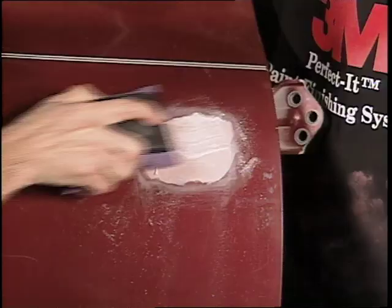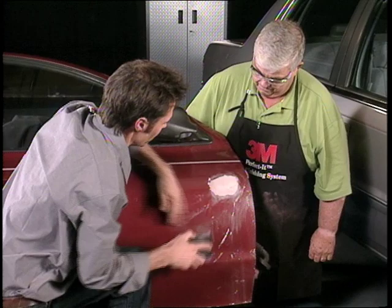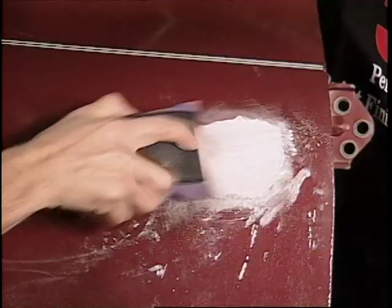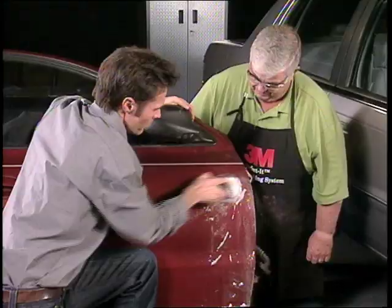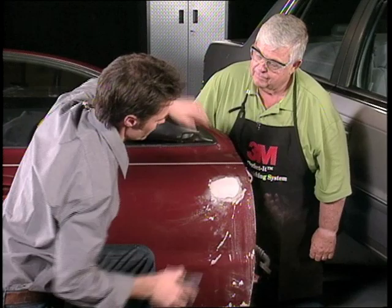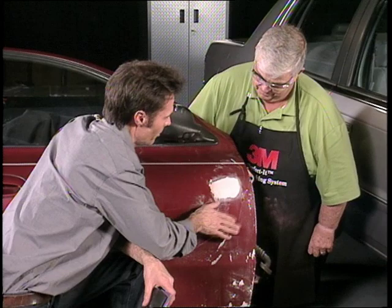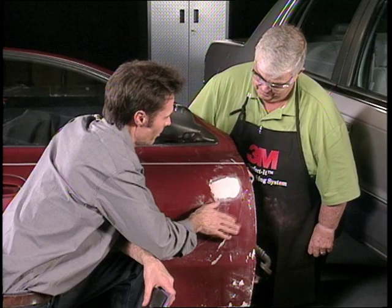Well, let me get sanding. And as you pointed out beforehand, you don't want to sand too much of the body itself — you're going to be contained in that area. Oh mate, it's bringing back the memories — the smell of Bondo. Smell of dollars! You know, one of my first projects was 177 door frames — I must have used 20 gallons of Bondo. That's feeling good. So it's 80 to the 180, and then it's prime and paint — prime, 320, then paint. Good stuff. So I'm going to continue, finish it off with this, change the paper, and we're ready to prime and paint.